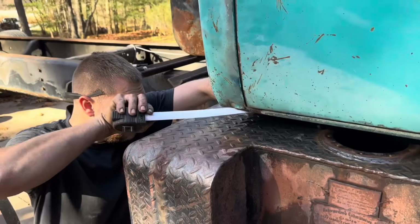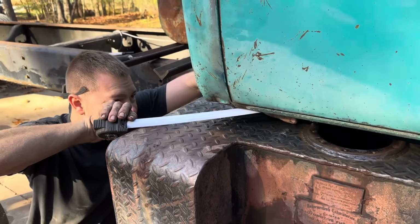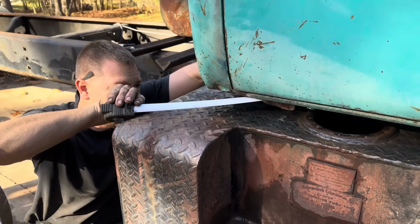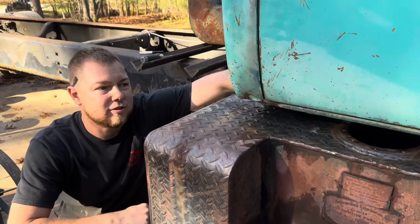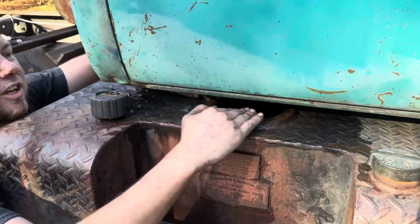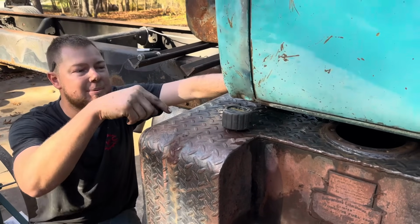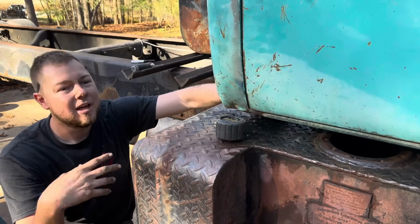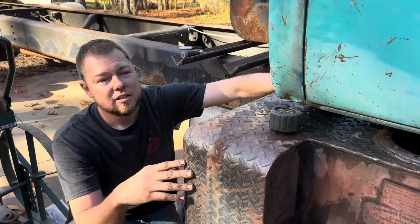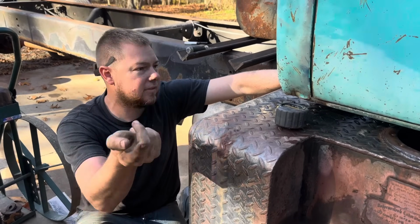It's almost too bad you don't have a 7-inch thing you can sit down in there. That's right at 2 inches to the top, or actually 2 1/4. So it would work if we use this hole, as long as you're okay with that. Well, why would I not be okay? I don't want to get fired. All right, so let's take it down. Let's cut the top of this tank out. Let's fill it with water one more time. It's probably good, but we're being safe today. So let's get both our tanks beside each other and graft the tops into it.